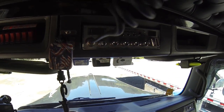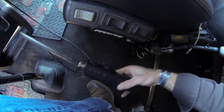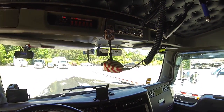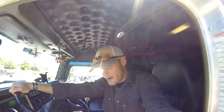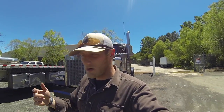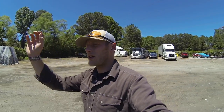We're going to be adding a second radio - a UHF/VHF radio so we can talk on private channels. We'll be able to talk at a further distance to our pilot cars than with just a standard CB. One thing people forget: they'll put huge powerful CBs in there running maybe 100 watts - illegal as crap - and that's great because everybody can hear you, but you can only hear as strong as the person talking's radio is. Somebody 20 miles away might hear you on your super powerful CB, but you aren't going to be able to hear them, so it's kind of pointless. We have two UHF/VHF radios and two handhelds at the house - all that will get thrown in the truck.